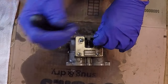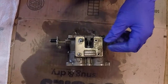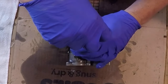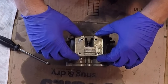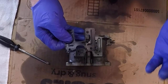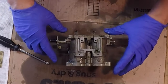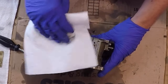Let's get all these screws off. I like to set everything aside so I know what I've taken off and when I take it off, so I'll put it all in order. Taking off these screws here, I know that I started with the top part of the carburetor. I'll take off this lid here and let's get this gasket off. I'll set the gasket over here so I know what I'm doing. Let's wipe it up a little bit — we're going to come back and clean all this up.